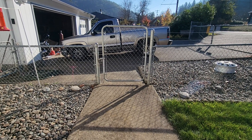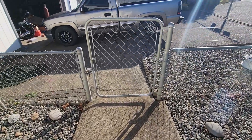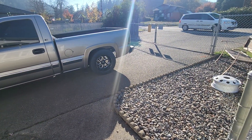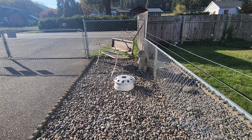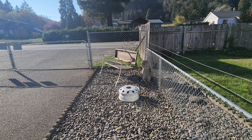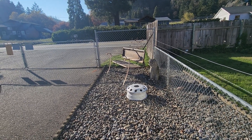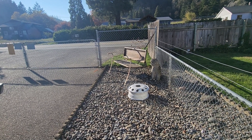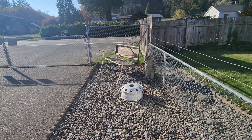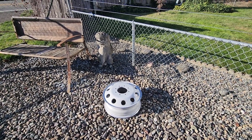What I wanted to do a video on is not the truck, but the wheels I've got for my big truck, my ramp truck. These are factory wheels that I'm going to show you that actually came on a Dodge. Because Dodge, Chevy, and Ford in the later years got into different bolt patterns. This wheel sitting here in the rocks is off a late model Dodge — the bolt pattern is 8 on 6½. Dodge is one of the only ones that didn't change their lug pattern for the longest period. If you're wanting cool looking mag wheels, these are it. They are aluminum, they were a high polish, I got a really good deal on them. They are a pretty pricey wheel for a factory wheel — guys want a lot of money for them.